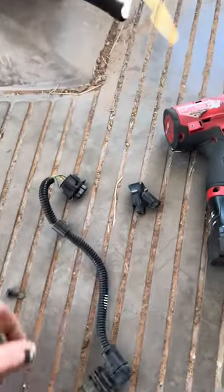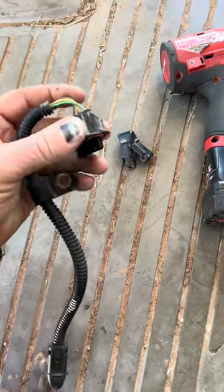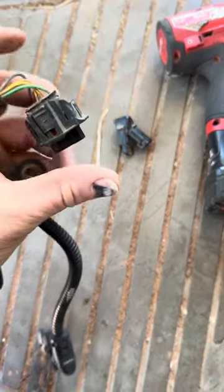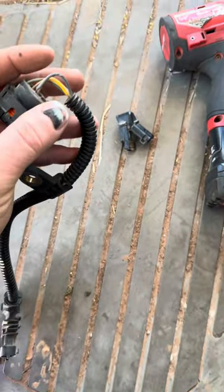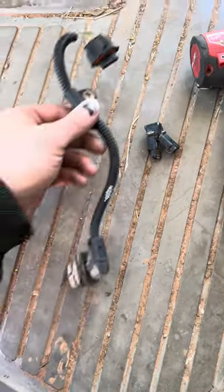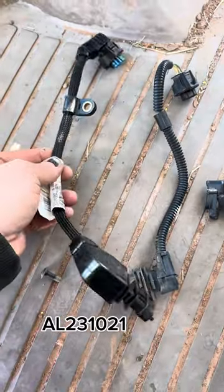What I found was when I unhooked the sensor and checked my pins, everything looked good there. So then I pulled the cover off the top here, I was inspecting the bend, and sure enough I had a broke wire. It's just too sharp of a turn there the way that harness is mounted, and they've got a new updated harness to help prevent that, so I'm gonna install that.